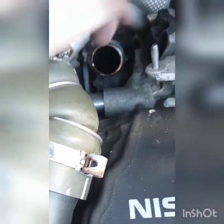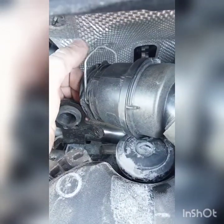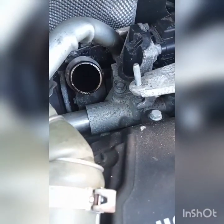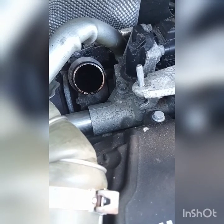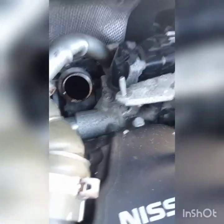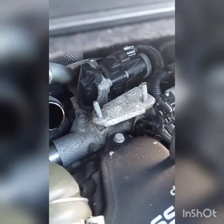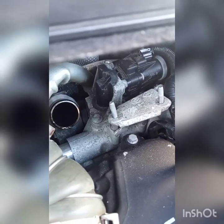There's a bit of a problem getting onto this bolt — you can't get on because this pipe is in the way. So you've simply got to pull this clip up with a screwdriver, then the whole thing just pulls forward off the turbo, just so you can get access to that bolt. It's impossible to get on otherwise. I'll get that whipped off and then the EGR valve should lift straight up and out. Fingers crossed.